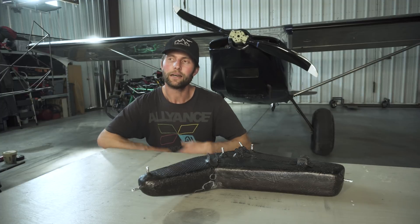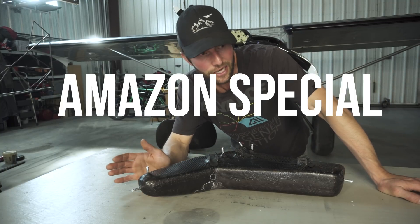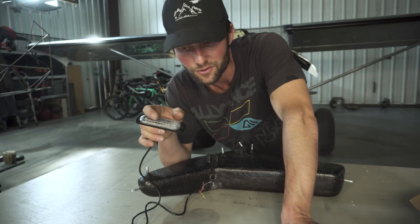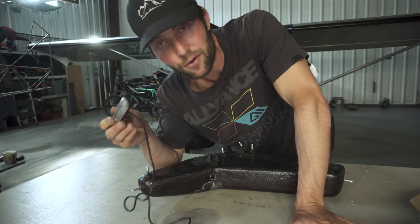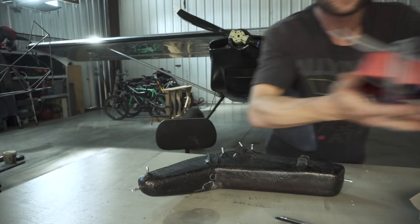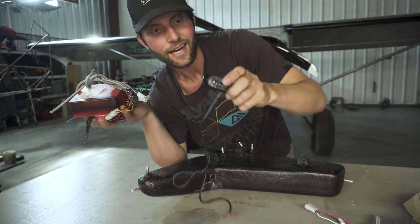I still have not tried VGs, but I'm excited to try them. The other thing I did that I thought was really cool is I changed my LED strobes out with an Amazon special — I'll leave a link in the description. Basically you get nav lights with strobes, all different settings, but there's one setting where the red nav light stays consistent and the white strobes. It was $25 for four, but you've got to buy a set of green and a set of red, so that's $50. The strobe is all built in, so all you have to do is get power to them. I was able to get rid of my ginormous strobe that I had on there before that just looked terrible, and I got rid of the strobe box too, which is like a pound and a half. Way, way, way better. I highly suggest these for anyone building.